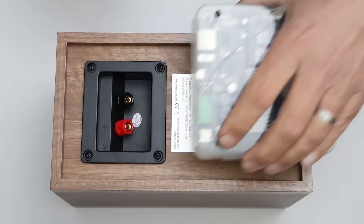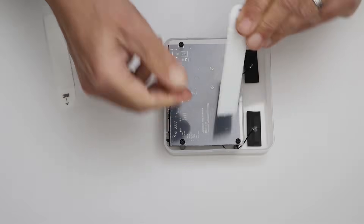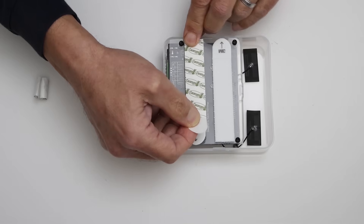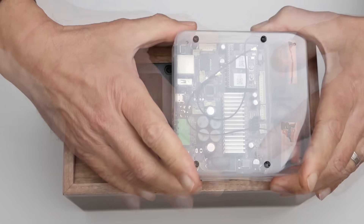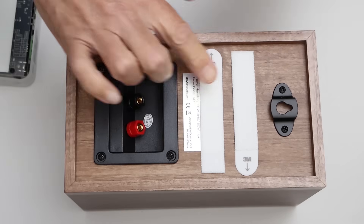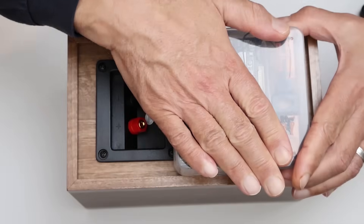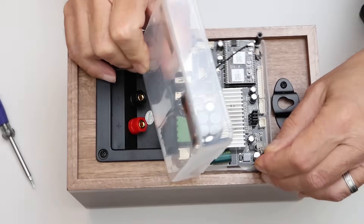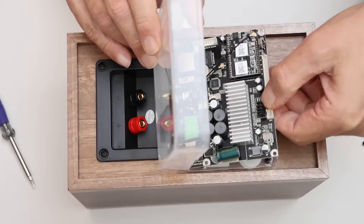I'll be putting the Wi-Fi box into this area of the speaker using four 3M hanging strips. We start by peeling off the backing on two of the strips and sticking them down to our Wi-Fi box. Then we very lightly press the ends of the hanging strips into the other side and peel off the backing. Next, carefully position the Wi-Fi box on the speaker and push down firmly. Now remove it quickly — the hanging strips should be in the right position on the speaker. Press them down firmly and leave them for an hour. Then place the Wi-Fi box on the speaker and push down firmly so that the hanging strips click together. If it doesn't click properly, you may have to remove the cover and board and push the strips down so they click. Now it's firmly attached on both strips all the way across — replace the board and screw the cover on.